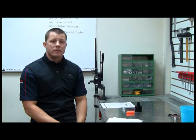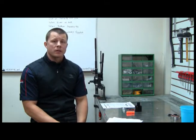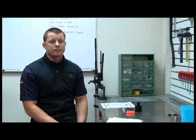Now, I'm sure you've heard all the benefits of ceramic bearings. They roll smoother, they have less friction, and they're more durable than steel. But dirt and other contaminants will rob you of these performance advantages, so it's important to maintain them. Cleaning and re-greasing your bottom bracket is going to maintain those performance advantages and contribute to a longer wear life.